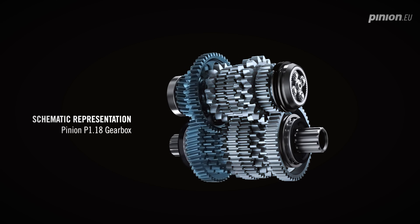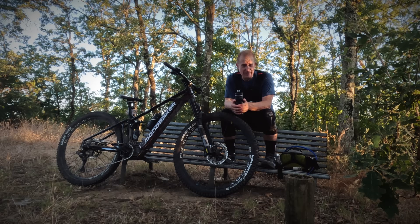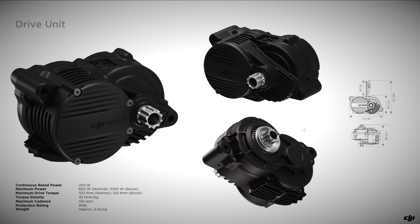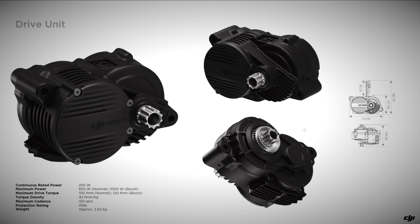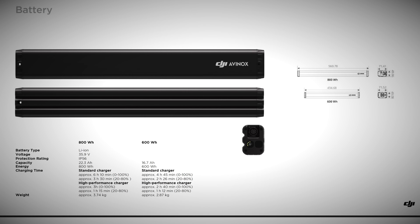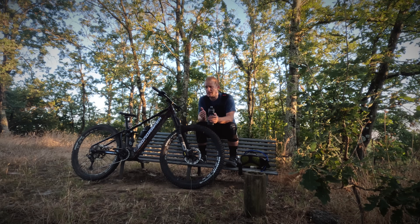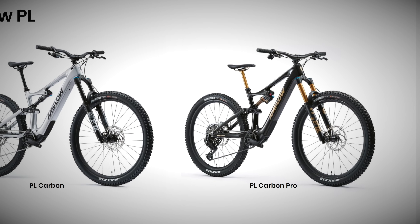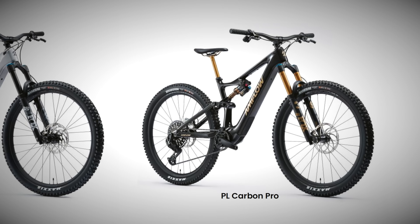The DJI motor - power, lightweight, but it's 2.5kg. It's only 200 grams less than the Bosch race motor, so it's not that much lighter. The battery energy density, yes, that's an improvement. The bike they've put it on is the Headline 19.2, but it's a trail bike - it's not an enduro bike. As soon as you upgrade the tyre casings, suspension to enduro level, you're talking 21-22 kilos for a full-power bike.